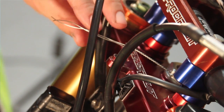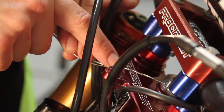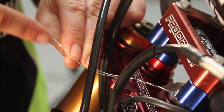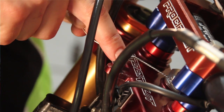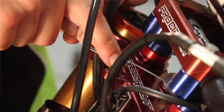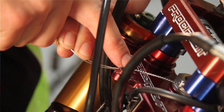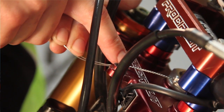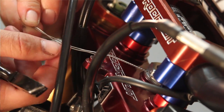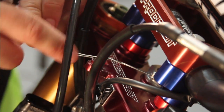One of the key things to getting safety wire properly put on is that you need to measure the point where you want your twist to end. So if you wanted to wrap around this little portion here — the triple clamps — just kind of measure: you're going to have to eyeball where you want your twist to end, and that's where you're going to actually grab the wire and then twist it to that point. If you just grab it anywhere, it'll twist all the way out and then it doesn't look that clean when you want to wrap it around something.